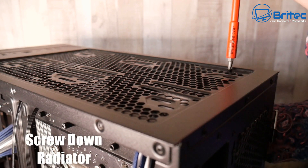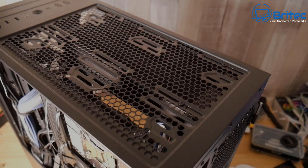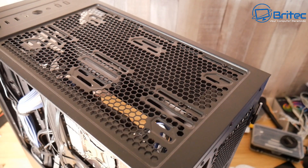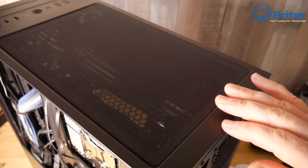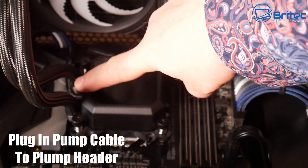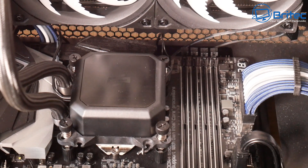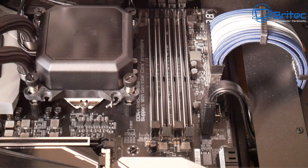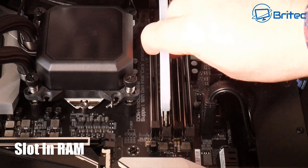Don't over-tighten, only tiny little screws, but there are plenty to hold it in position. I've got all the screws in apart from the middle ones — just a couple more to put in. Once done, position the radiator how you like it and put in the dust cover. The pump header on the board is now plugged in and the cables look nice and tidy routed around the back. I had to remove the RAM to get the pump in, so I'm putting it back now since the fans were stopping it from going back in. Line it up and slot it back in — you should hear a clicking noise when you push it down.